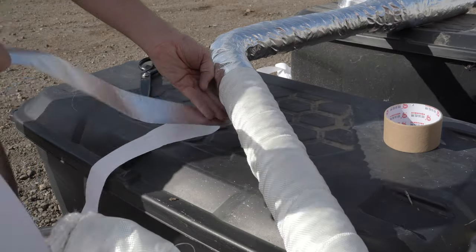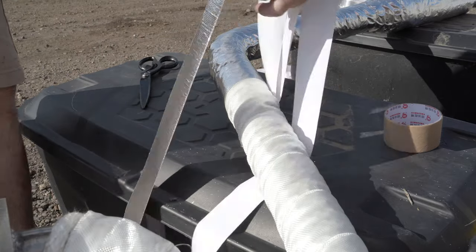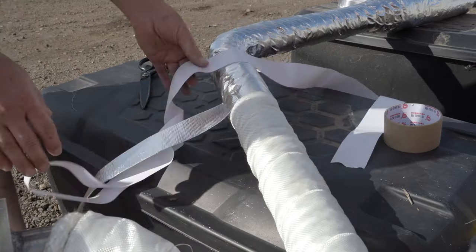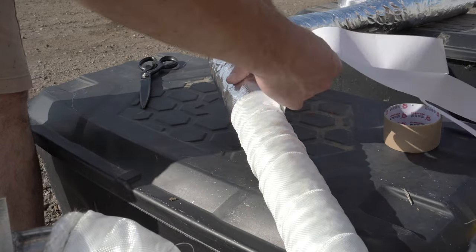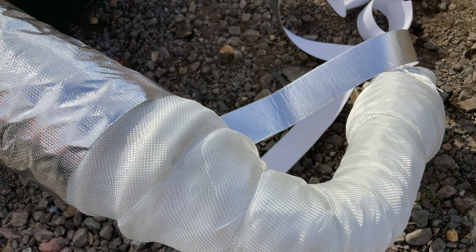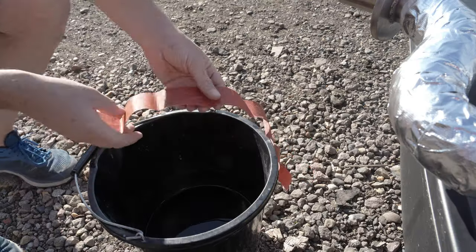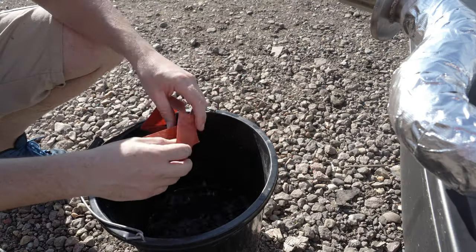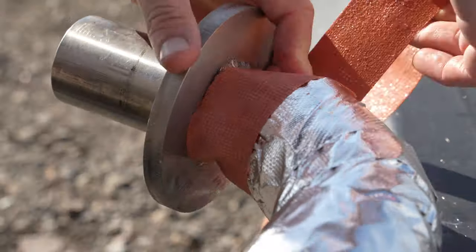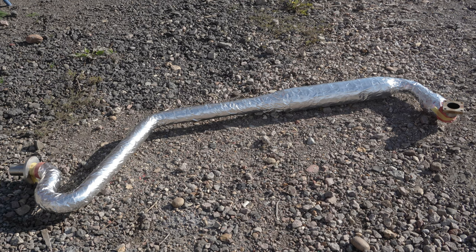I appreciate that all sealing of this type is imperfect, and if any dampness gets through it'll not leave as easily, even if the pipe is 200 or 300 degrees — but we all must bear our unresolved struggles in life. The special adhesive on the tape is good, but not that good. It won't stay bonded to hot pipe itself. So I'm wrapping the two ends in exhaust pipe repair cloth first, and then taping over and back onto the lag section. I was happy with the end result, and in my victory lap of lagging enthusiasm, I'd realised I'd completely forgotten something. Two things actually. So, surgery.